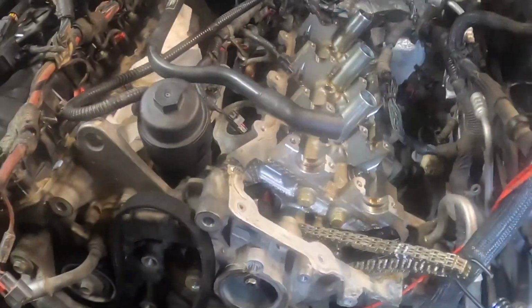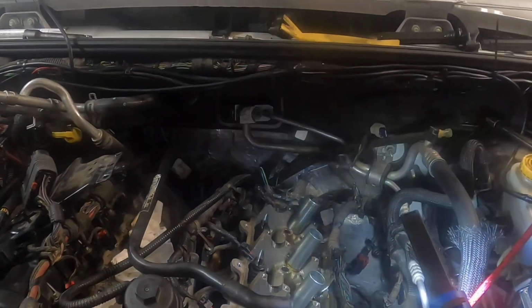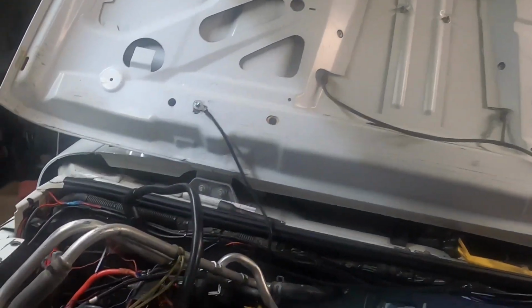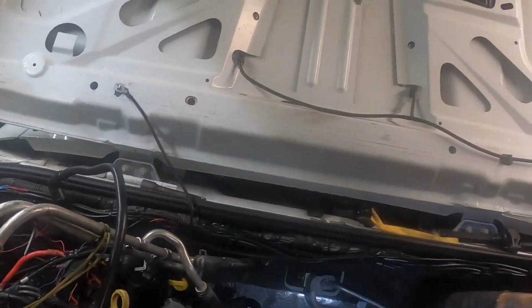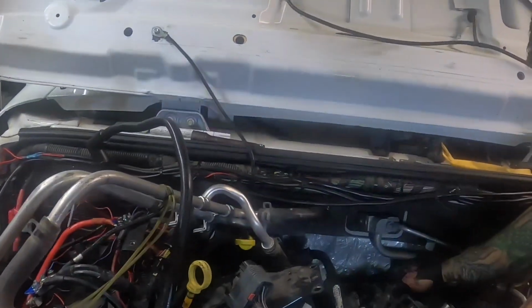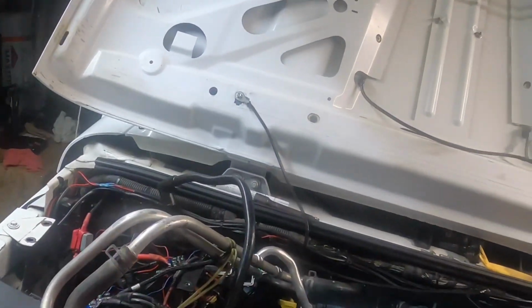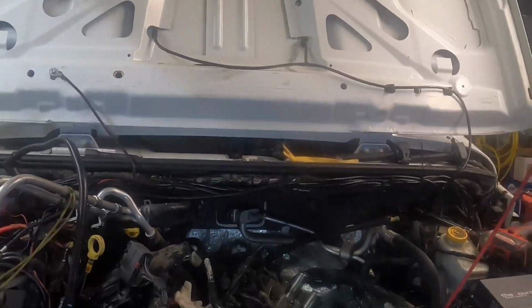There's that AC compressor suspended. So now it's not attached to the head anymore. The flange bracket's off back there. The coolant temperature sensor is unhooked. And I think there's one connector on the back of the head that's plugged in back there, has to come off with a little, what do you call it, a little Christmas tree clip or whatever. That's it. All right, let's do the head bolts and then we can take a look at that valve, man.